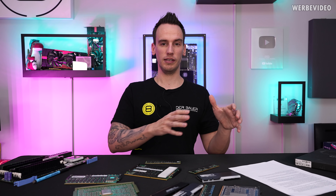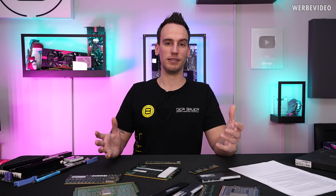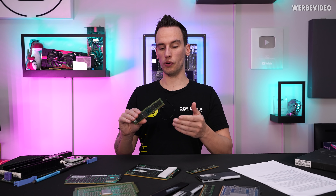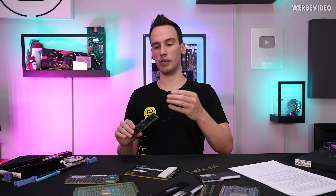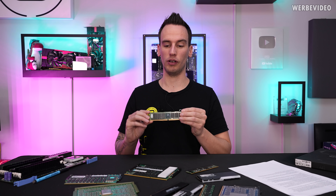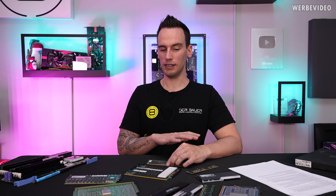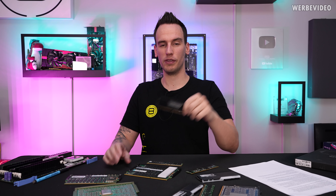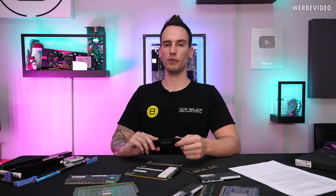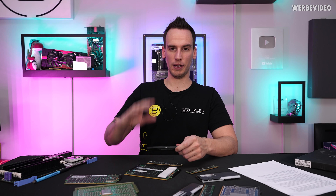You can extend server memory capacity by 1.5TB by combining six DDR4 DRAM sticks with six PMEM sticks. Compared to the NVDIMM it also stores information permanently but does not require an external power source — at the same time it's cheaper and has higher capacity, making it a very interesting technology. Overall the things we saw in today's video are very special and something we typically don't come across with ordinary DDR5 memory sticks. I hope you learned something, and if everything works out we will be able to see some Power 9 and 10 servers in action soon. Thanks for tuning in, see you next time.